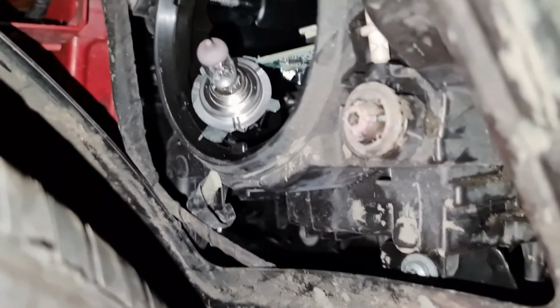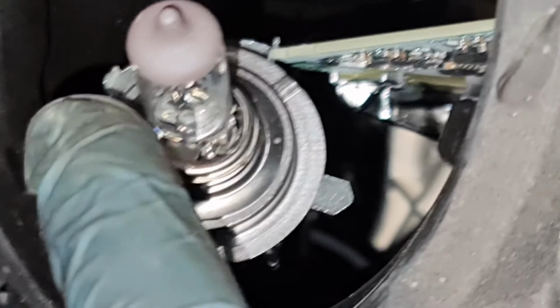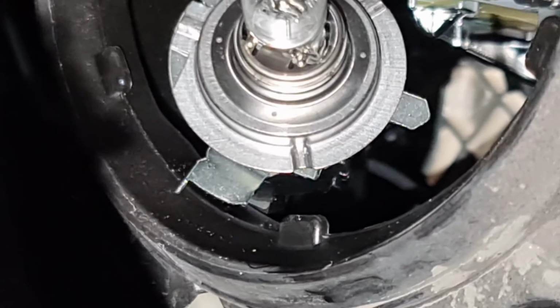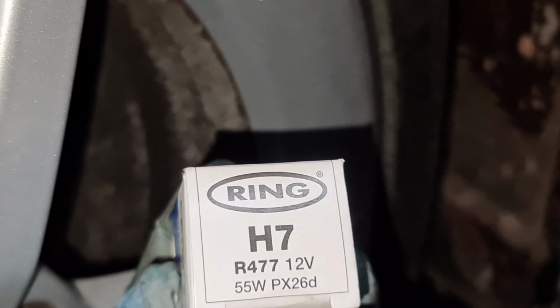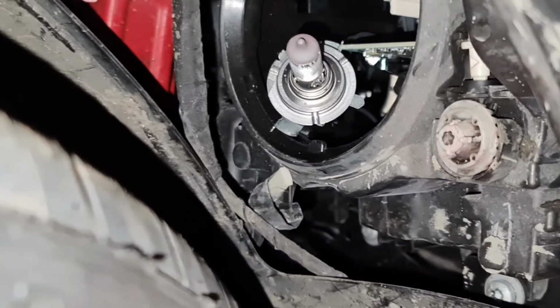When I pull it out, as you can see now, the bulb, if I zoom in a little bit, you see the locator right there, so there's a stopper there as well. So that's how the bulb needs to go back in. Just remember that bit. Zoom back out. The bulb you need is an H7 bulb. You will find the link for it in the description, where to get it from. They are quite common bulbs for the headlights. I'm going to show you how to replace it.